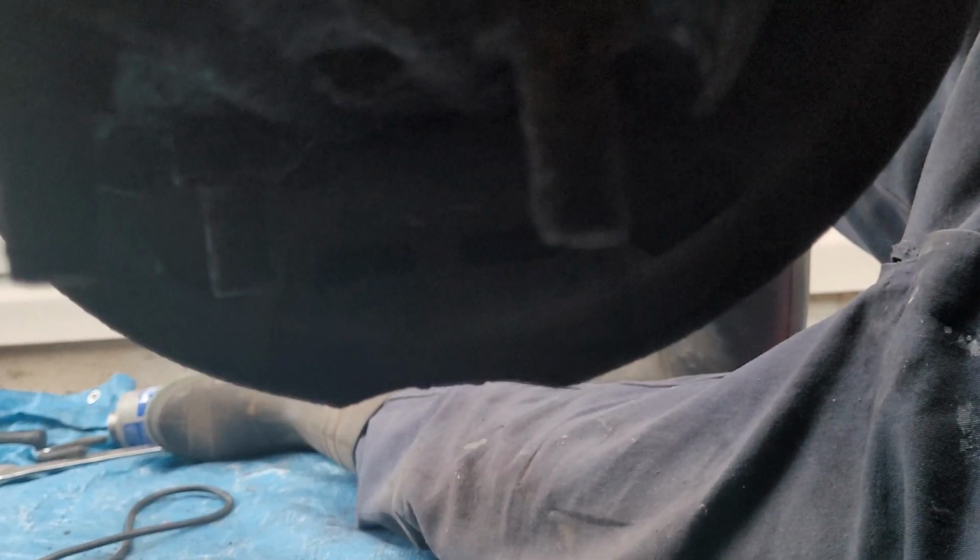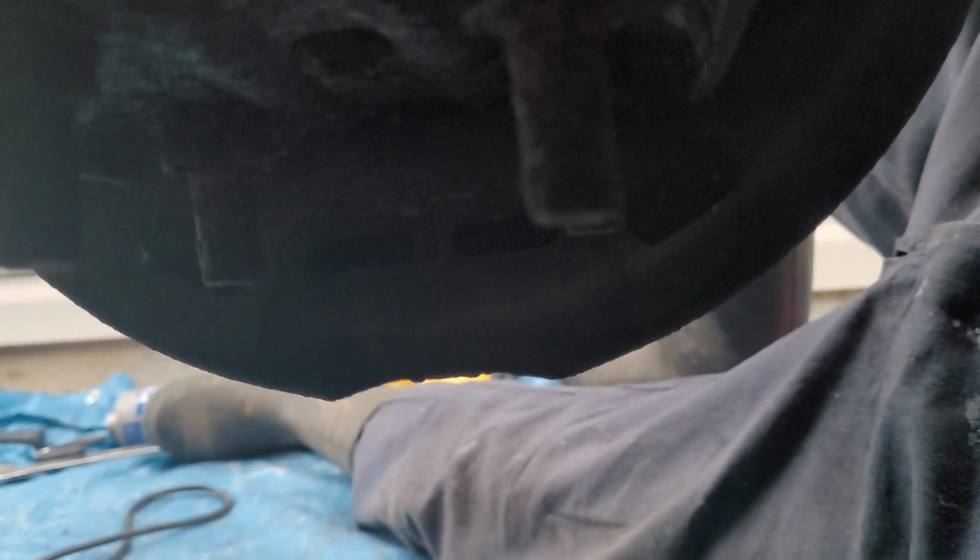Forget what one way or the other, I don't know. Depends on what side of the trailer that you're on, up or down. And that will tighten the brakes. Way to do that is turn your drum. It's free right now. You want to turn it to the point where it won't turn, so there's a little bit of drag, then back it off a little bit, maybe 1 or 2 clicks, and make sure that it's spinning freely after that, and then you just adjusted your brakes.